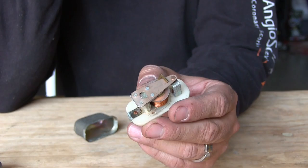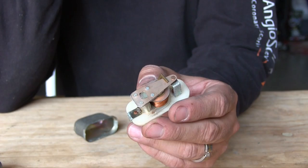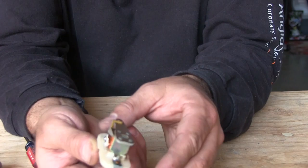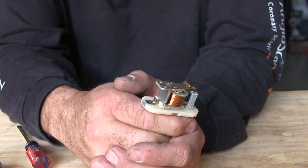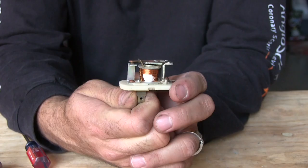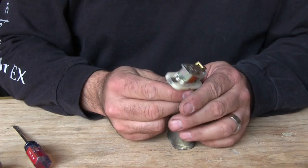This tang here is the ground for the relay — when I put it back together, I need to make sure these two meet the shell. I was reading John's thread on AusRotary; the gentleman goes by the name of Gypsy. He discovered the ignition relay is only used to bypass ballast resistors while the starter motor is turning. If I don't need ballast resistors because of my ignition setup — which is possible because I'm going to go with an RX-7 setup — I may not need an ignition relay. More on that later.